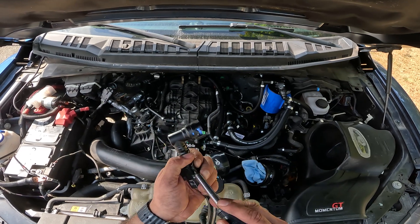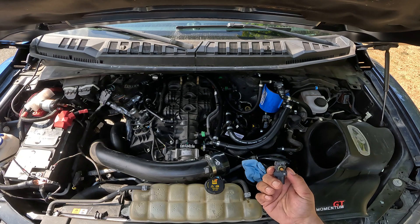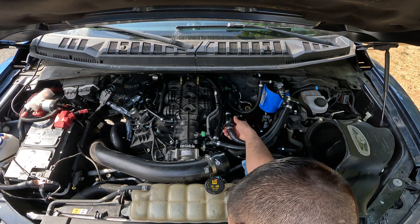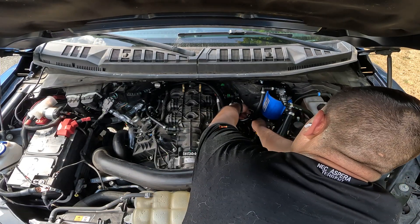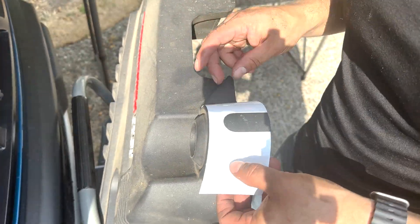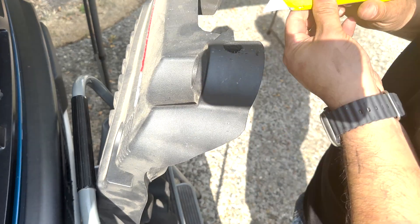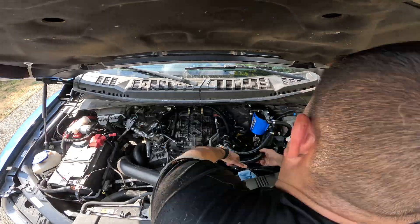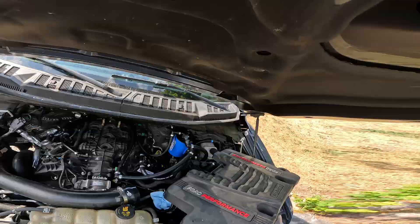This little sensor on the driver's side needs to be swapped over to the new hose, so I popped it off with a little flathead screwdriver and installed it with the plug port pointed to the rear of the engine bay. Then I plugged in the wiring extension on both sides. Since the new oil filler neck has an extra inlet, you need to cut out a portion of the engine cover — I used a hole saw and a box cutter to cut it out. I couldn't get the engine cover to fit properly, so I played around with re-routing the hoses and finally got it to fit.